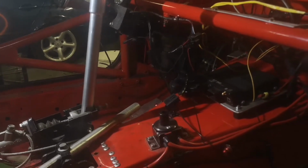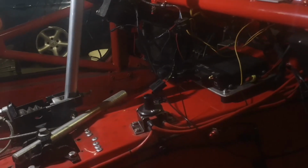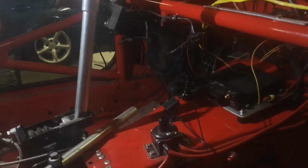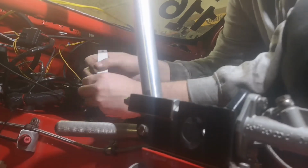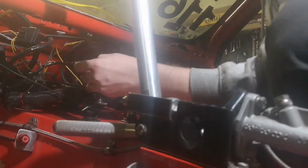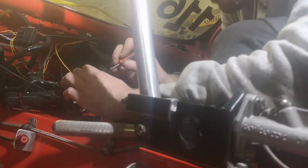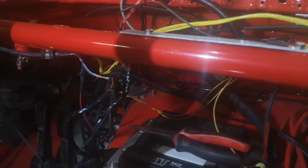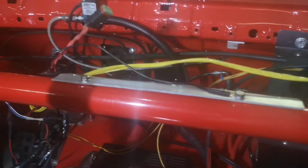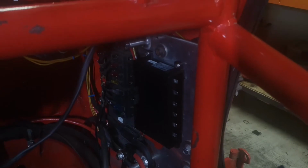And since I was a doofus when I mounted this the first time, I broke a couple of the locking tabs for the pins inside of the not pre-terminated connector, so I gotta remake or repin that connector to match up with the new one I made. So the connector is now rewired and ground is hooked up, so now it's just to hook everything up to the PDM lookalike thing and we can power on the car again.